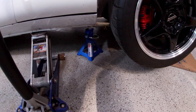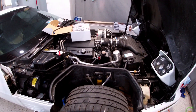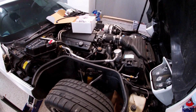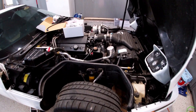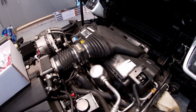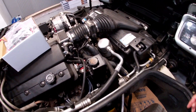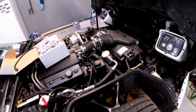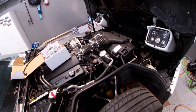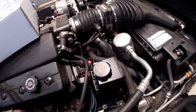I've got the car jacked up with a jack stand underneath. I'll be accessing everything from this side of the car — I'm not going to jack up the other side unless it becomes more of a chore. First thing is to take apart the air intake and get that out of the way, then drain the radiator by pulling the hose off and letting the coolant out, because we do have to pull the water pump off to get to the Opti-Spark. Water pumps will fail and leak, getting the Opti-Spark wet, which can cause failure — but that's just part of owning one of these cars.